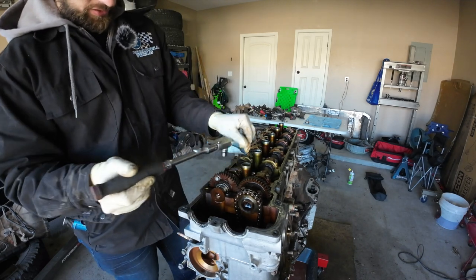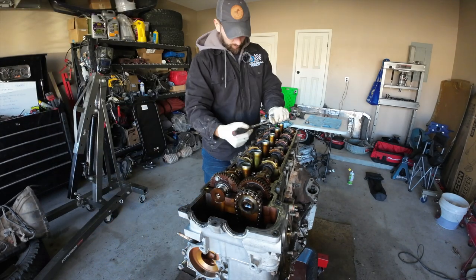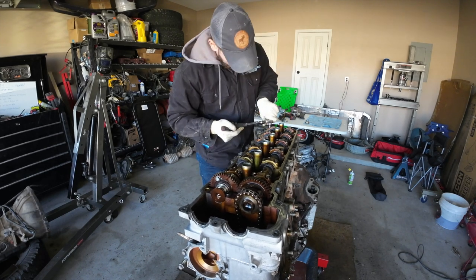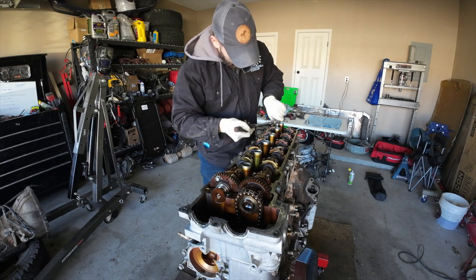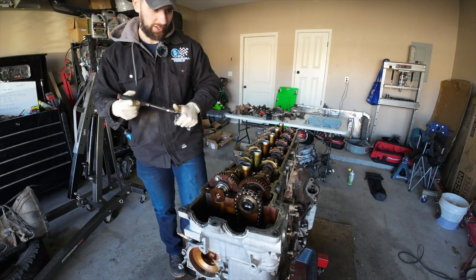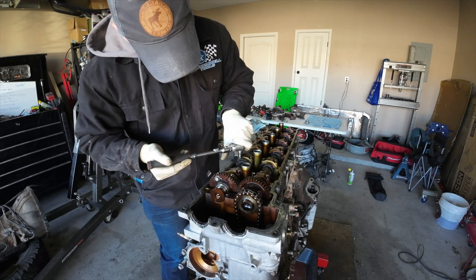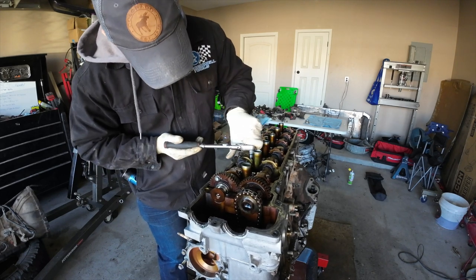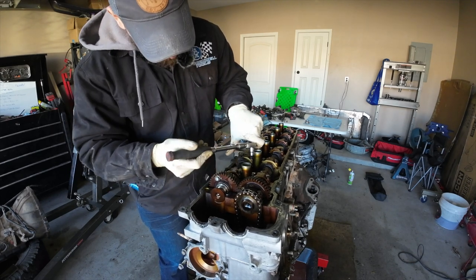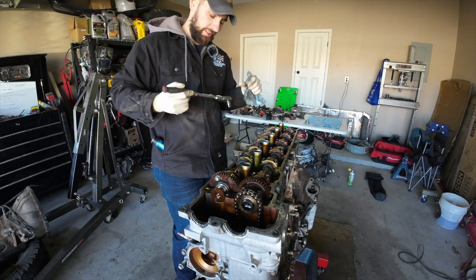Okay. So it doesn't say to do this in the factory service manual, but I'm gonna go to the back and take number 7. Remember, we're skipping 4 and 6. Back to this one, to this one. There we go. Now I'm gonna come back up to number 3. Crack loose. There we go. A little bit at a time, guys. Nothing crazy. And then basically once they get to the point where you can take them off by hand, that's when I'll just take them off by hand.